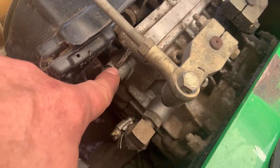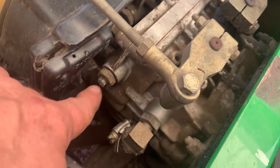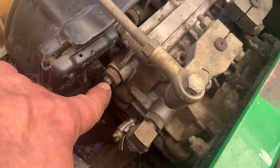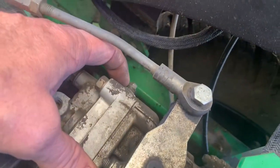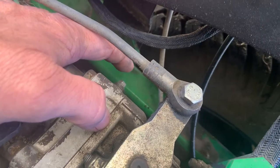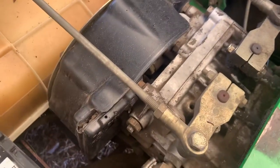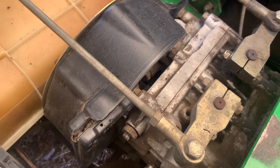When you want to free wheel it, crack this big nut loose and back it off a little bit. Then back the center one out a few turns. There's one on each side of the mower — there's one right here too. The lock nut is missing off this side, but here's the center bolt. You do this on both sides, and once you back it out, this zero turn will roll very, very easily.